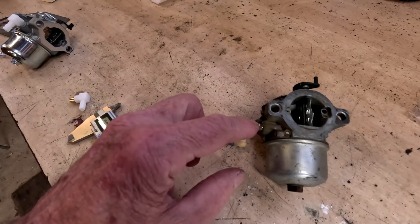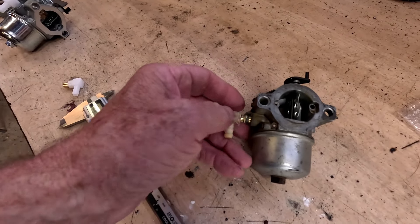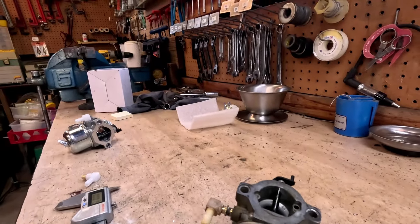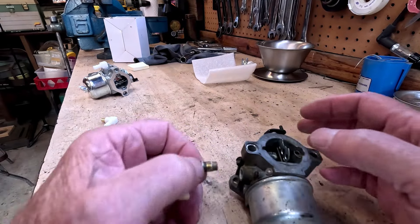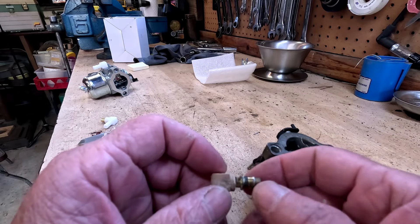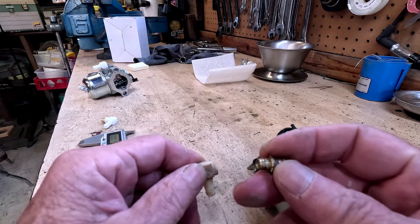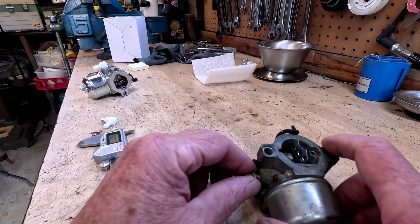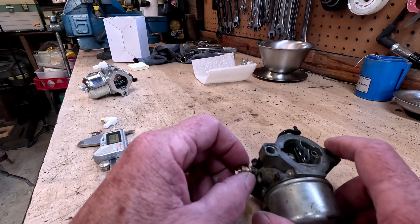The valve was leaking around this little plastic fitting, so they wanted that replaced. I figured it would just come right out, but I hadn't really fooled with replacing one of these before. To get this thing off, I went to pull it out and it's just pressed into the side of the carburetor — no screws. I was thinking it was probably screwed in, but this part just came right off. To get it out of there was quite the job — you have to build a little puller for it.